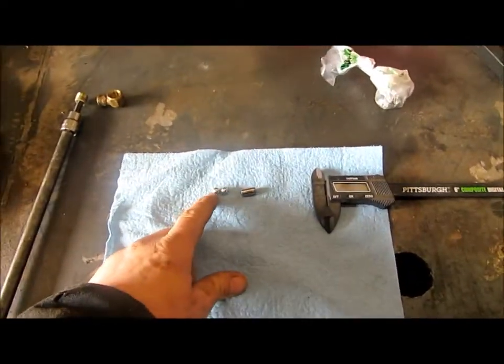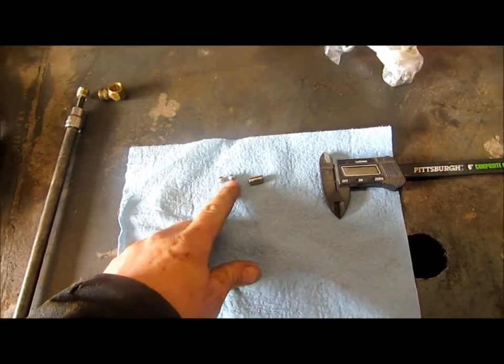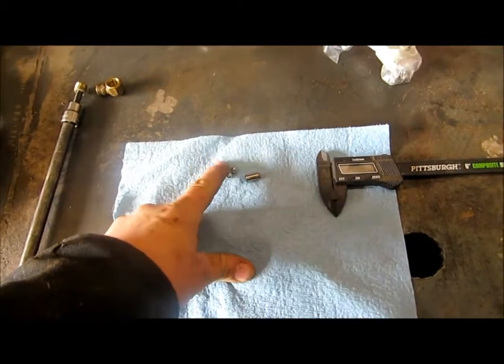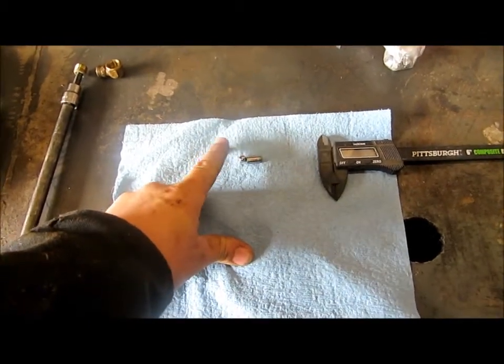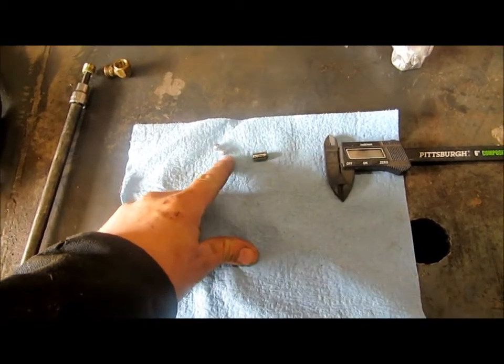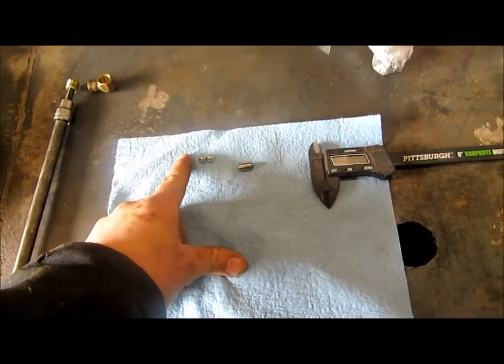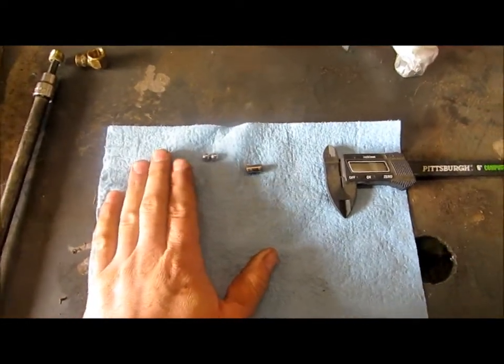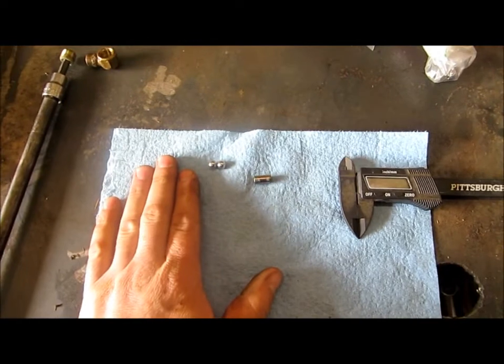So I've tried to go back to this 2-ball bearing idea. The Polaris tech had turned me on to using 1-ball bearing in the past with a spring and then put the piston in on top. But I tried this 2-ball bearing mod a while back and I was not sure about how successful it was because I still had lower oil pressure at idle.